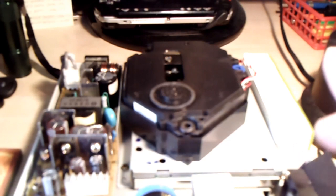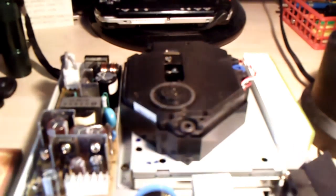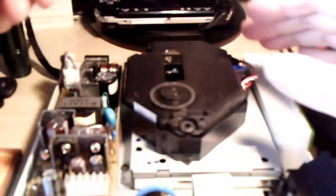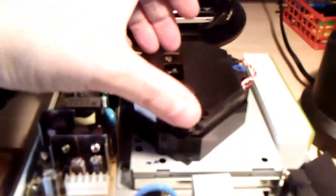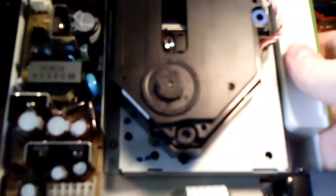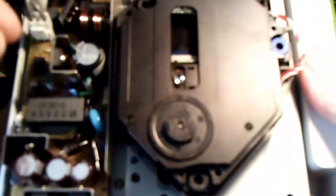All right. Machine powers on, doesn't read discs. That's the bottom line. Whether they're backups, games, audio CDs, might read one, but not the other. What's the problem? Okay. What you want to do, first of all, to be able to access the area you need, see the lens right there? Obviously, all your discs that you've tried and you're having a problem with, you've cleaned them and you've concluded that they're scratch-free and they did work before.